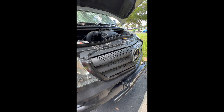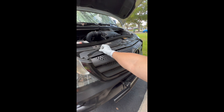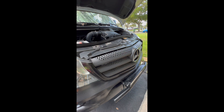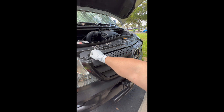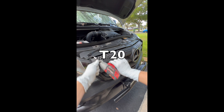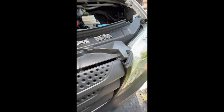Now that we have all that on, just take the snaps, make sure the plunger is all the way out, get the tabs in, push in — done. The large screw goes right here and that is at 20 torx. Work your way around and get all those put in — T20 torx, four on top, one on each side. Make sure all this is pushed and clipped in.